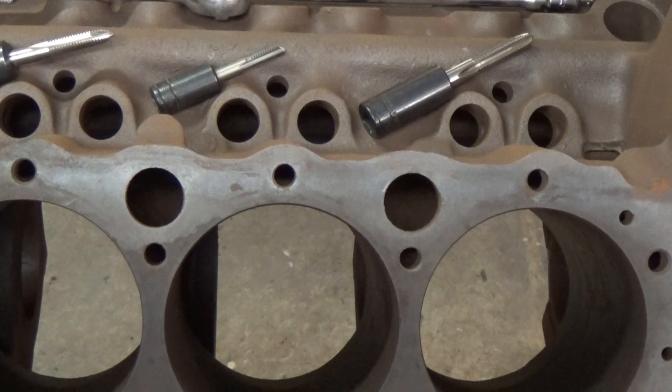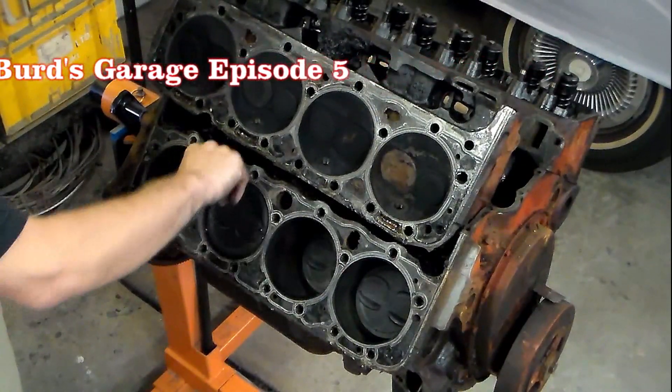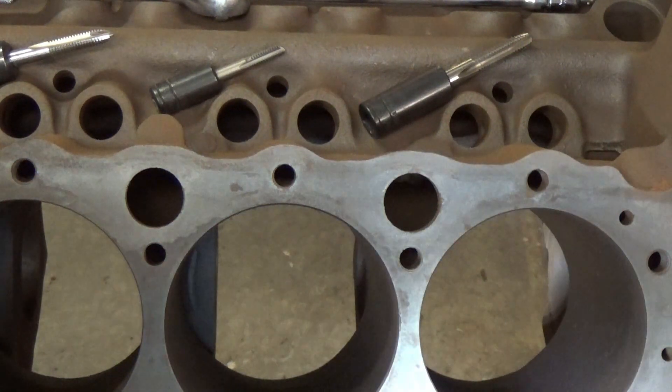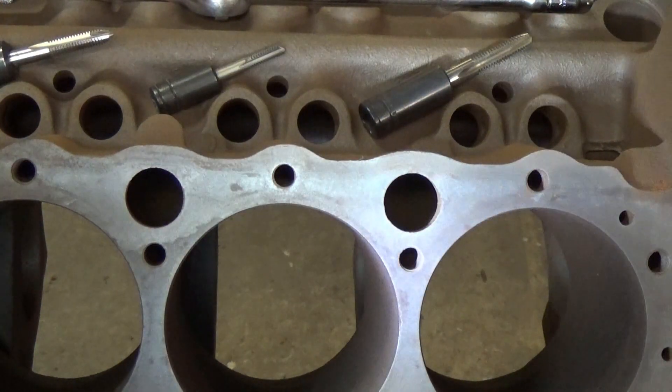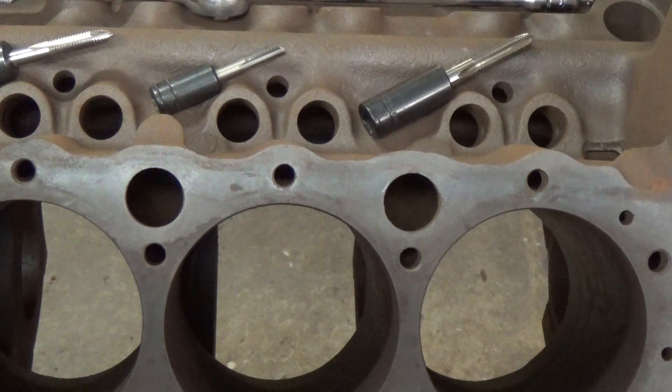Before I start working on the block, I wanted to show you what a nice process the debaking is. If you remember from previous episodes, the block was full of oil and the coolant ports had blockage and really bad scale. Now there's absolutely nothing in the block but a little bit of rust. Normally it comes out as bare cast iron, but whenever you get the block back you want to put oil in all these cylinders so it doesn't start rusting — because right out of the oven it can start flash rusting right away.